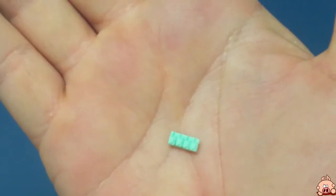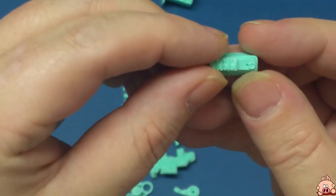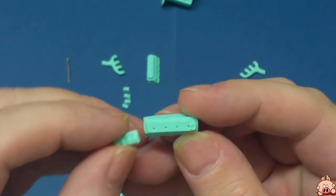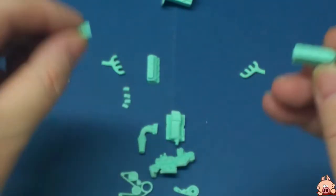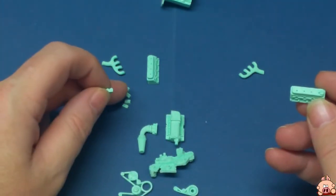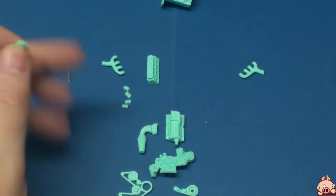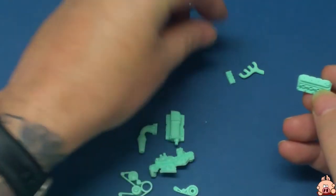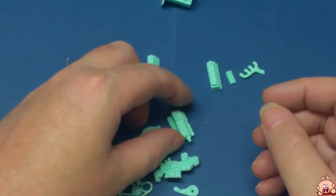Now you can leave that coil block together and just simply attach it to the valve cover. But if you didn't want to cover up the bolt heads for the valve cover, then you can do as I did and separate them, as I've shown here on this side. So this way you can locate those coil packs wherever you wish to do so.